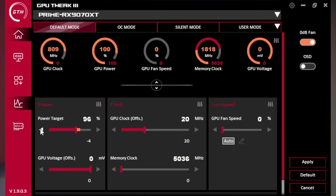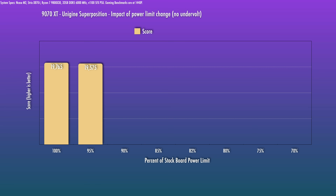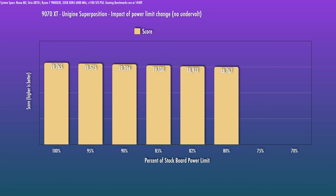The first thing I want to do is figure out how much inefficient power I can shave off. We can infer that AMD was gunning for the 5070 Ti pretty hard and pushed a lot of power just to get as close as possible — when you're within three to four percent of the competition, every little bit counts for marketing. That final mile comes at a big cost though. Dropping to 95% power, you still get 99% of the benchmark score. At 90% power, still 98%. At 85%, 96.8% of the score.